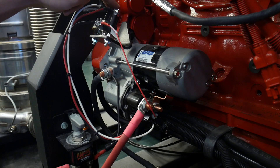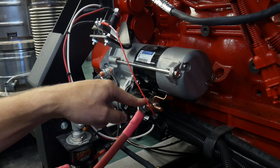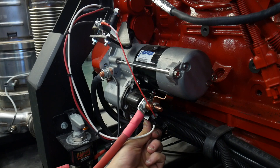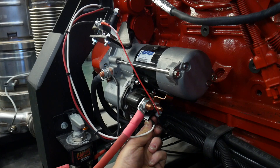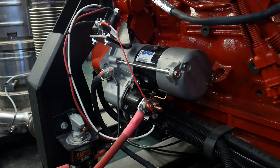The relay has a red wire coming into it from the same position as our battery connection that comes into the mag switch. This white wire on the back side comes off of that and goes into our pull-in and hold-in terminal on our controller. This mag switch will operate our pull-in and hold-in coils inside the starter.